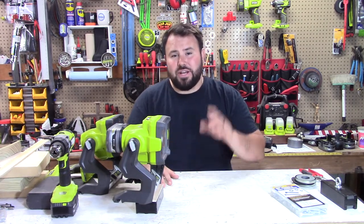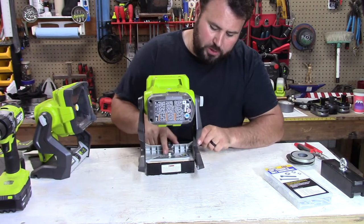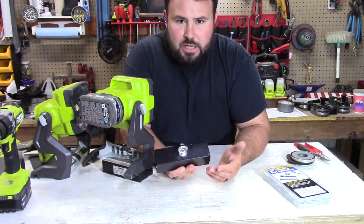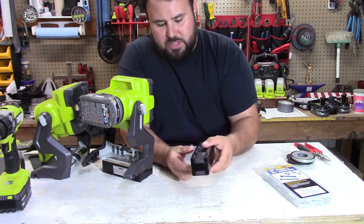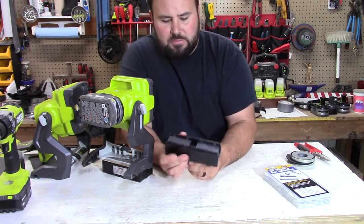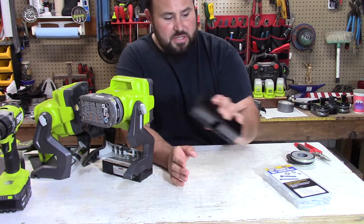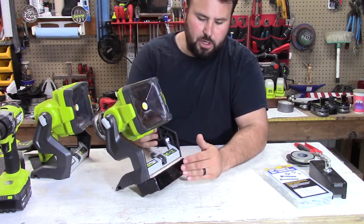Today I'm going to talk about how I make these and how I safeguard my vehicles. The light is mounted to the magnet — I already have a mounting pole here, typically for a tripod, but we're modifying it and just going to bolt the magnet to it. This is a typical magnet you can get at Home Depot or Harbor Freight for around 10 to 15 dollars. It has two or four big magnets down below. I do suggest using a 250 pound pull magnet if you're going to use a single large magnet.